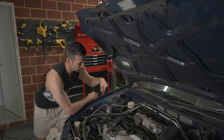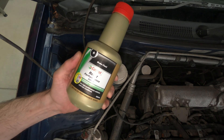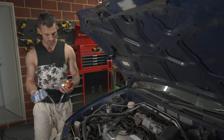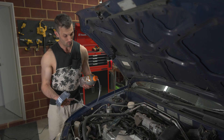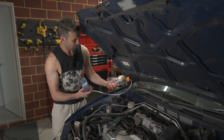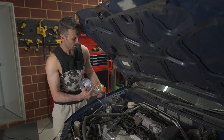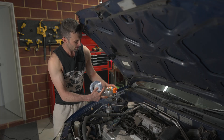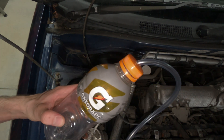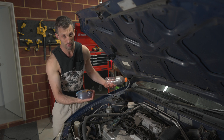The rear right, front left, and front right follow after. I've got Castrol React — this is Dot 4, and this car takes Dot 3 as well. I've got one liter of that, and a one-liter bottle with a wide base so it'll sit nice and firm, with the tube pushed in all the way to the bottom. The old brake fluid taken out of the reservoir will partially fill this bottle so no air back-feeds into the brake line. I'll cut the tube to length — about 500 to 600 millimeters — once it's in place. The tubing is 6 millimeter internal diameter.